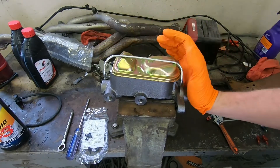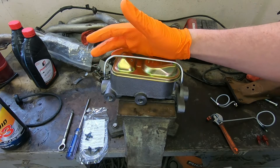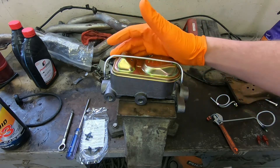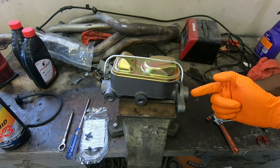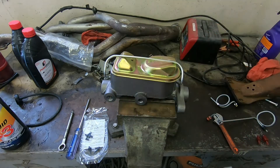The first thing you want to do is set your brake master cylinder in a vise — that's the best thing you could probably use, or any other type of device that you could secure it. That way it's not going to go anywhere because you're going to have to work this plunger and run your brake lines up into your master cylinder.